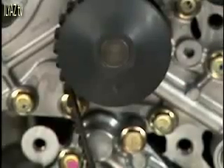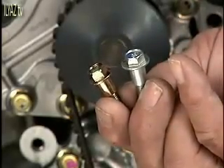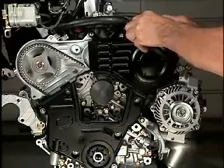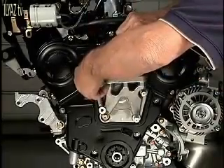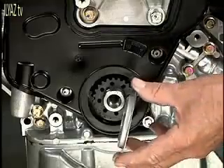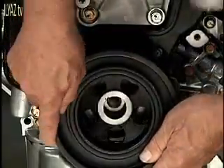There are silver and gold bolts used to retain the timing belt covers. Make sure the correct bolt is used in the correct location. The silver bolts retain the bottom cover and the gold bolts retain the two cam covers. Now go ahead and install the engine mount. Install the crankshaft pulley washer or dust shield with the step facing inward toward the engine, then install the crank pulley.